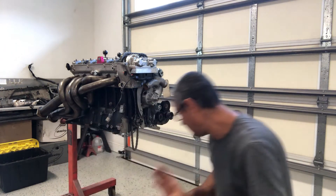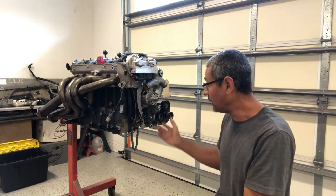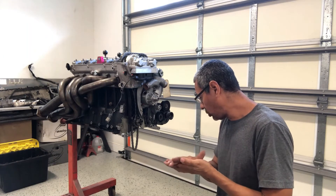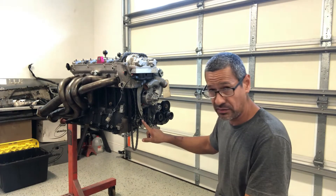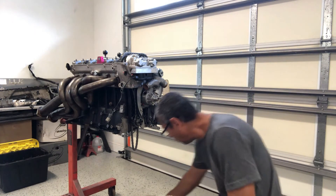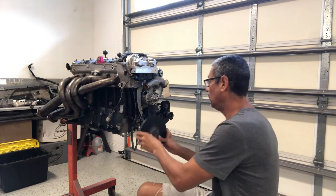With all that done, technically at this point I should be able to reassemble the whole motor — put the new oil pan gasket on, timing gaskets, all that stuff. But as I started looking a little bit more closely, I realized that this little dowel pin right here on the actual crank sprocket hub itself is slightly damaged. So when I go to put my balancer on, she moves a lot, even with the bolts — she moves around.